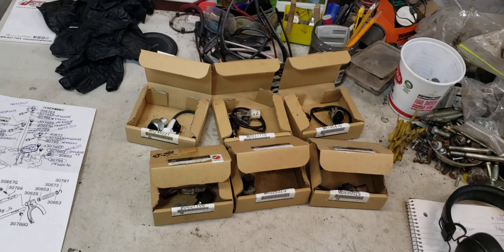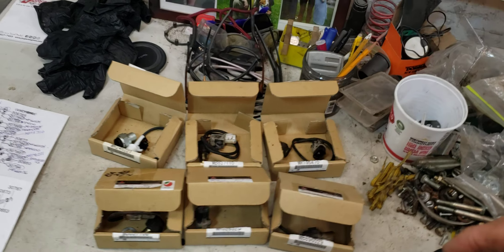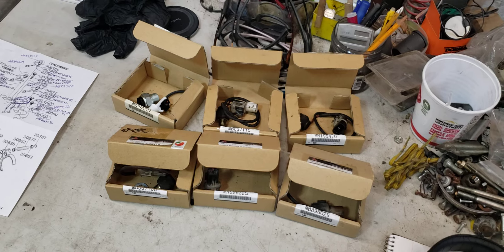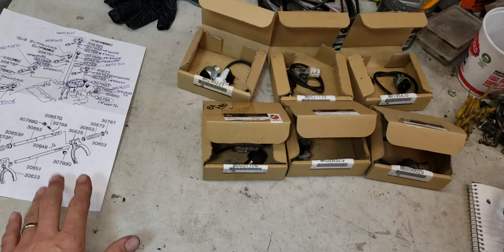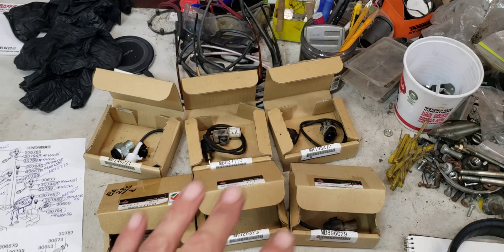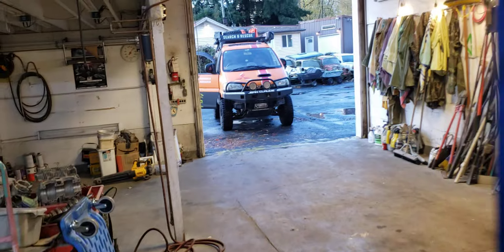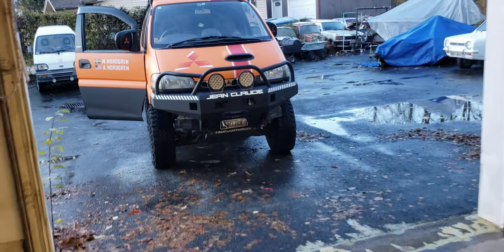It's a little while after working on our Mitsubishi Delica search and rescue van. We replaced all the switches that were on top of the transfer case. Had to drop the transfer case down about six inches. It was a little difficult, but I got all the right switches in the right spot — they're all individually different. Every switch has its own spot. We got the van out here running and I'm happy to say the center diff now works.